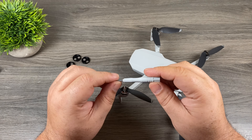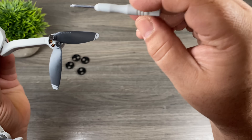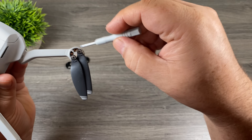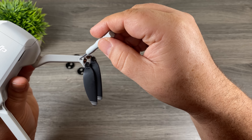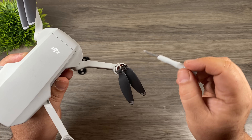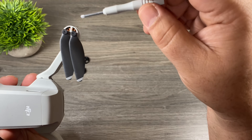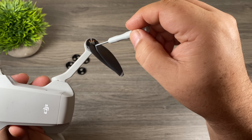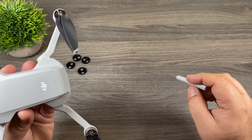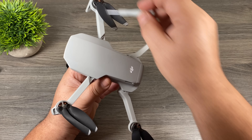You will need to use the screwdriver that comes with the Mavic Mini. There are two types of propellers installed on the Mavic Mini. You can see on this arm that these propellers have a little dash around the screw and there's also a dash on the arm. When you take them off and put them back on, make sure you put propellers with a dash on arms with a dash. The propellers with the dash also have an extra line on them. The arms with no dash and no dash on the propeller have a single stripe at the tip. The propellers on each side are the same, and vice versa.